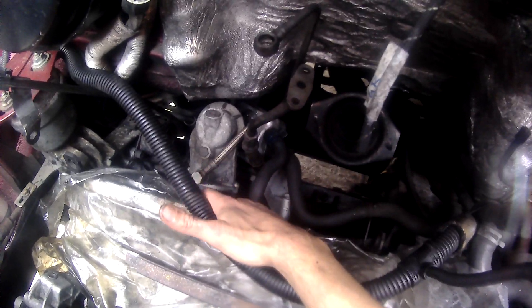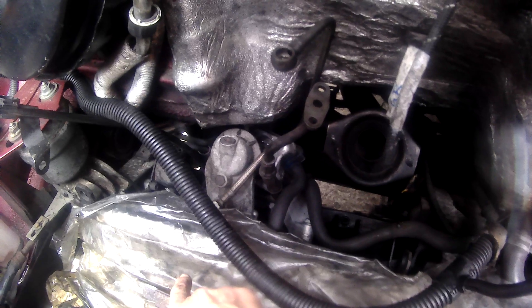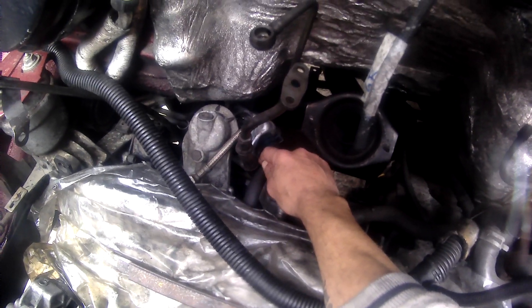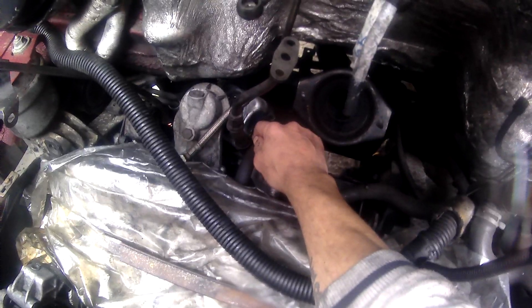Right. Nothing else to do at the moment — still waiting on things. I've also measured the bore, and the bore's 81.1. So while I'm waiting, let's go check the sizes in the Haynes manual. I've measured the bores again and I'm going by the bore that's the worst, which is actually Cylinder 2. That felt like there was a flat spot — I mentioned that in a previous video, that you could feel it. So I've measured that gap where you could actually physically feel it was different.